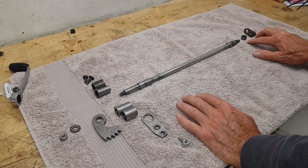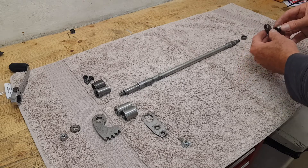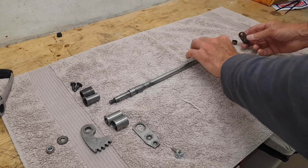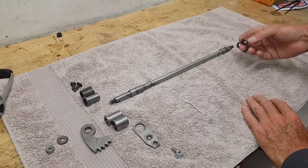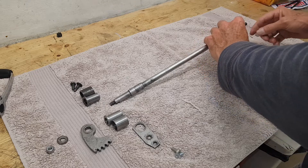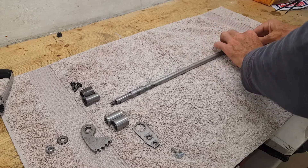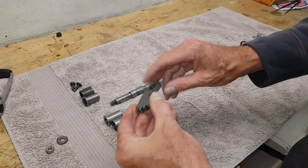On the timing side, there's this little strange linkage that sits in the fork. This slots inside that fork — a little spacer here — and then this spline link goes onto these splines. Before that, there's a little collet that runs inside a needle roller bearing. It comes through the roller bearing, then onto the spline, and moving that fork changes the gear. That's all done up with a nut when in place.